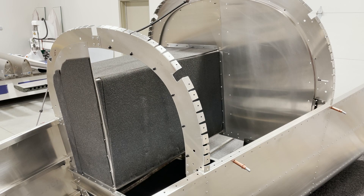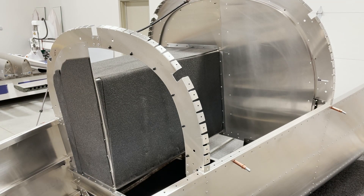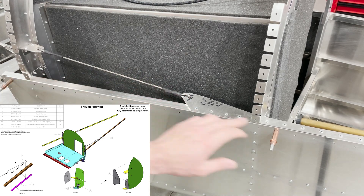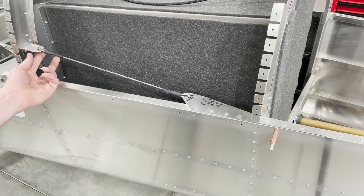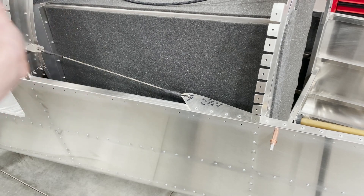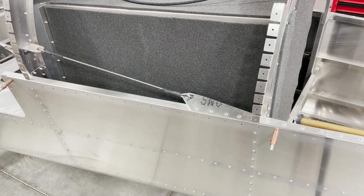When assembling the box, shoot rivets from the inside of the box facing out, so the tails aren't on the floor, wall, or roof of the baggage compartment. The next step is installing the seat belt reinforcement plate and cable. On the underside of the longeron goes the reinforcement plate; on top go the seat belt cable mounts. On the front end, try the plate in both orientations — it'll fit better in one due to the angle through the rib and mounting hole location.